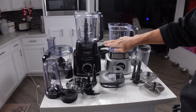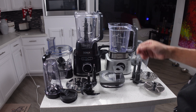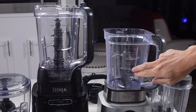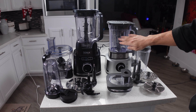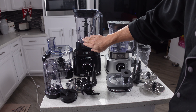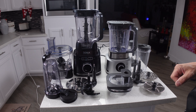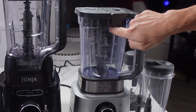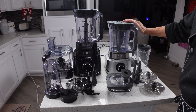Next, the pitchers. They're almost the exact same design, but these are not interchangeable between each other. The lids look exactly the same, but underneath you can see the pins are keyed a little bit differently. So you can set this on here, but you're never going to be able to lock it in — and you can't turn the blender on if the lid isn't locked in.